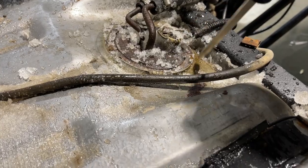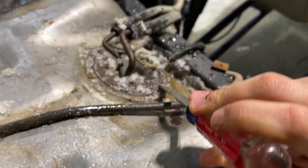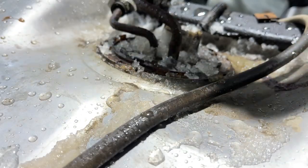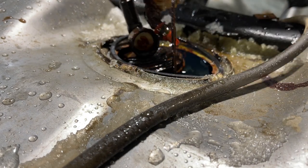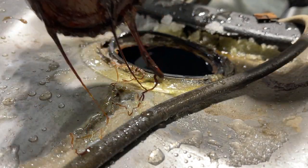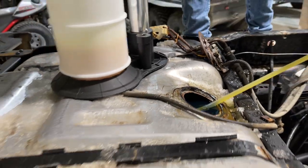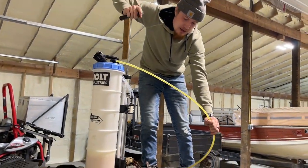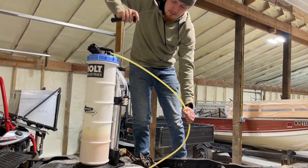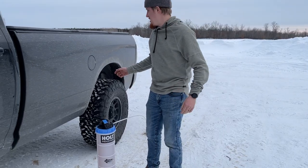The way to access this is there's a little ring on here — you can kind of see those little nubs. Basically you stick a screwdriver on there, hit the back with a hammer, and twist that ring over, and then it can pop right out. Look at that — that's what it's been picking up and trying to stick in my fuel lines. I put fresh fuel in here when trying to get it started, so a lot of stuff on top is good, but there's so much debris on the bottom of this tank. That's what's getting into my pumps, my injectors, and everything.